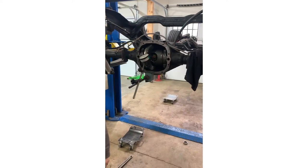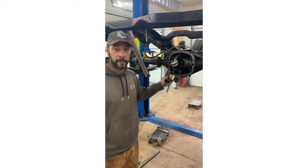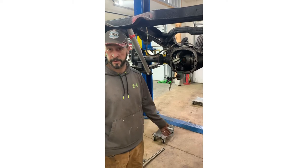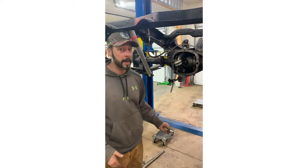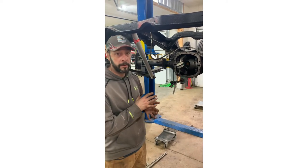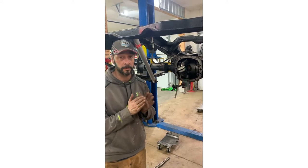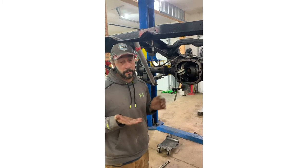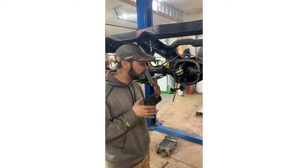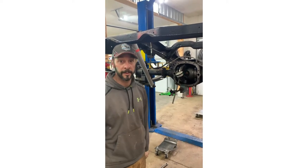After a few in-and-out cycles we've achieved our backlash. The spec is seven to nine thousandths - a pretty tight spec, with a general rule of thumb being six to ten. We are somewhere between eight and nine thousandths. We'll leave it there because once you put the good new pinion bearings and crush sleeve on, it tends to push the pinion into the case a little more, which tightens you up. Right now we're right in the middle at eight thousandths. Now we're going to paint some teeth and check our tooth contact pattern.